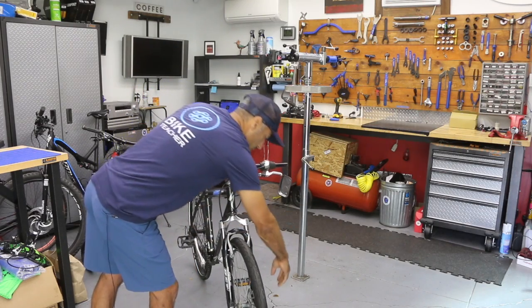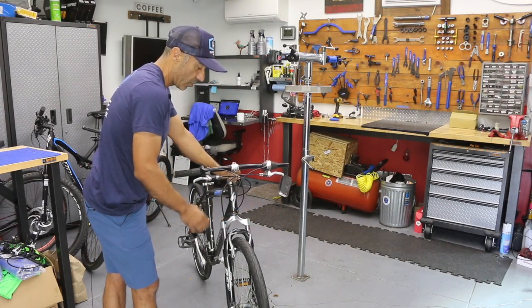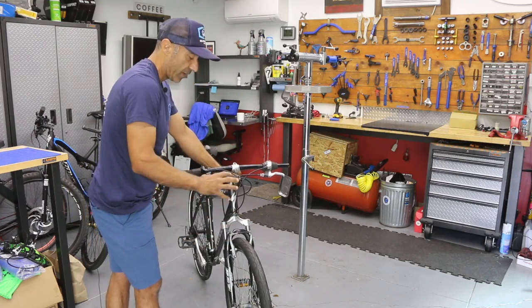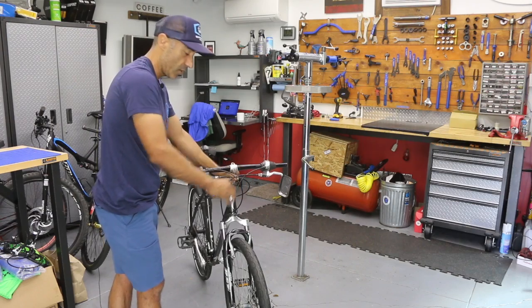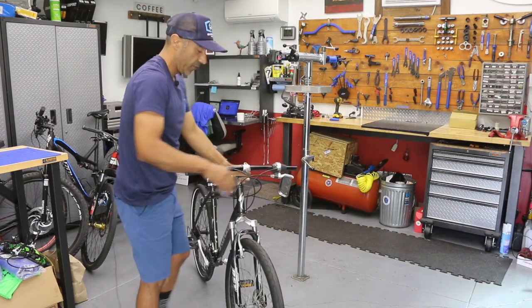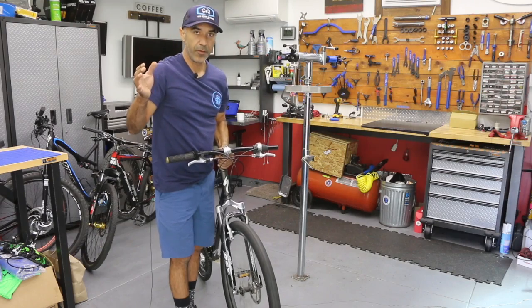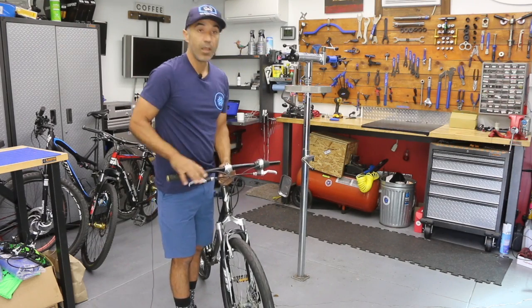So if we're crooked now, we're going to flip this open. I just saw it move slightly — probably didn't see that on camera — but I'm also going to give it a nice good tap. Want that vibration so if something's stuck, it's going to break loose and find its home. Now it's even. We're going to go ahead and close this back — all this without touching that front wheel. Lift the wheel back up off the ground. Now we're free again. Test that brake. Good to go. Hope that helps.